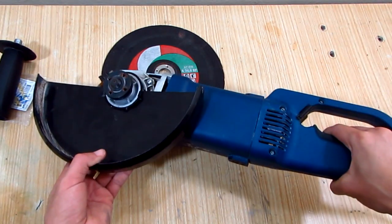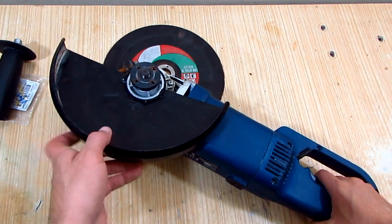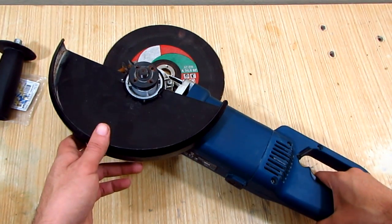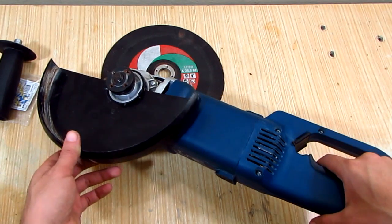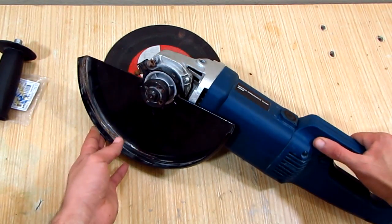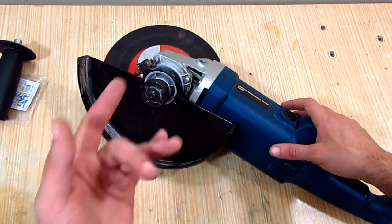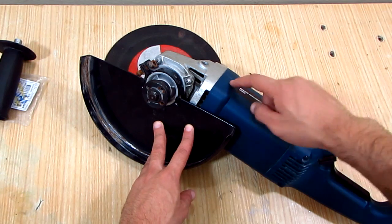I tried it and it's working fine every time without interruption. The sparks are reduced considerably and that strong burning smell disappeared. If you change the brushes and there is still a lot of sparks and burning smell, you may wanna check out the gears and the burning lubrication.